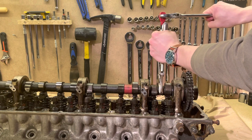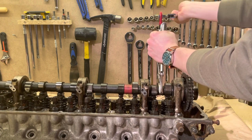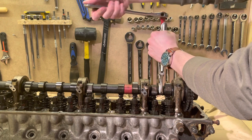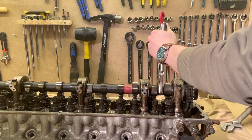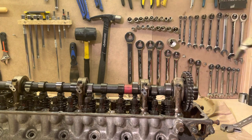Because the valve train is such a delicate area and these do have to go on pretty tight for you to be able to turn it, I think it's worth taking a crescent wrench around whatever your handle is on your vice grips and loosening it that way — it's a lot easier to just unlock them and bring them away safely.